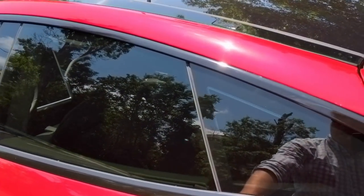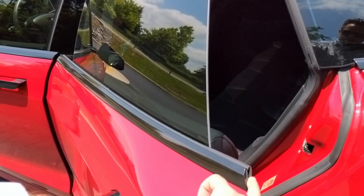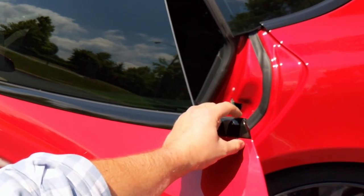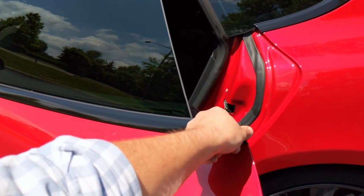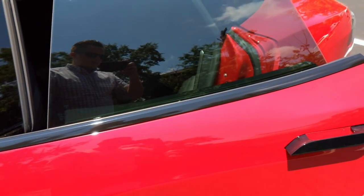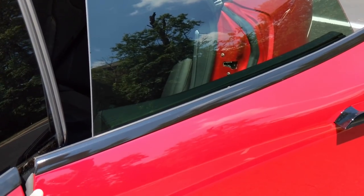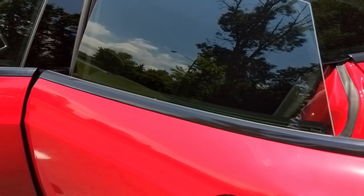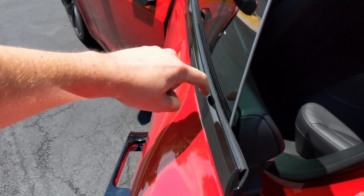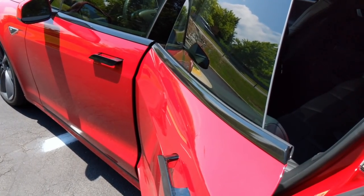These pieces here are the easiest to wrap on the entire car. Start from one side, it's nice and wrapped all the way to the corner. Take a piece two or three inches wide, start here, stretch it all the way down, anchor it on the other edge, and get all your wrinkles out. Super easy. Use masking tape on the bottom to keep it off the paint so you can really tuck it up underneath. There's a nice gasket seal in here — use your little tool to push it down into the gasket, then hit it with your knife. No problems at all — that was pretty easy.